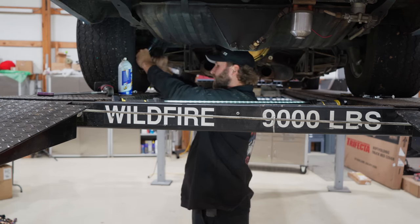Yep. Okay. Fuel Make It Happener is on. It's looking good. Used a ball stud kit from Edelbrock, actually. It's a nice little kit that has all the flavors. A little bit of lithium grease so that doesn't get sticky or anything like that. It's got nice throttle action. Be sure to torque these down in a cross sequence. And always check your throttle action after every one. Make sure it's not binding up either in your intake or your adapter there.